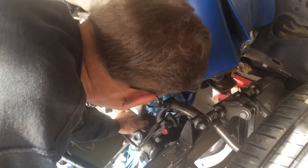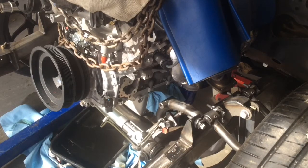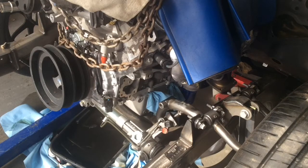There are some shadows playing tricks here, but this is the frame member down here and here's the edge of the oil pan. I measured it — it is two and a half inches from the oil pan going past the cross member. So in the end, what we need is three inches further back — a three-inch smaller oil pan. I say three inches because you've got to have a little room; you don't want it smacking into the cross member every time the engine rocks. We need a much smaller oil pan, and we need to modify the firewall for the high pressure fuel pump because that's what's sticking out the furthest. I think there would be enough room if we just had a different oil pan.